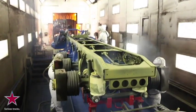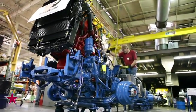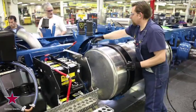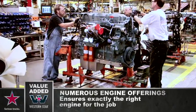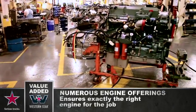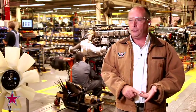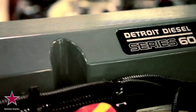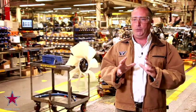That's some serious customization. Now assembled, it's time for the custom chassis to be prepared for painting. After a trip through the paint booth, the chassis goes through ovens where the paint is cured at up to 200 degrees Fahrenheit, or 90 degrees Celsius. After a cool-down period, technicians hang the engine package and make the necessary connections before installing the fuel tanks and batteries. One of the great things at Western Star is engine options: we have our own proprietary series of engines — 16-liter, 15-liter, and 13-liter from Detroit Diesel — and we also offer the tried-and-true Cummins ISX. For off-highway trucks that will never see the road, you can still get our proprietary Series 60 engine in a Tier 3 off-highway emission rating — no diesel particulate filter, no EGR, just a simple turbo and a muffler.